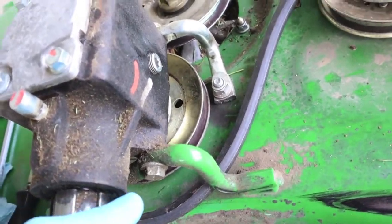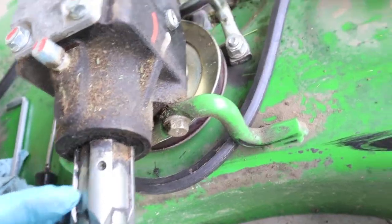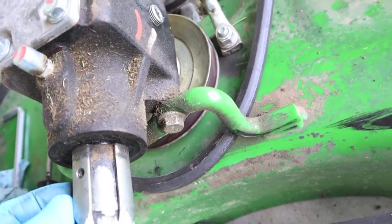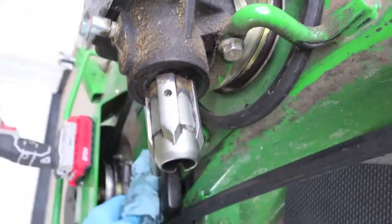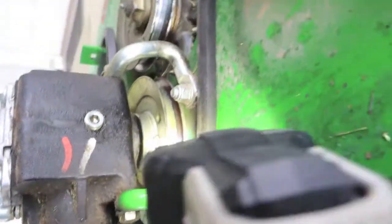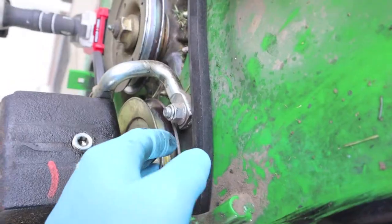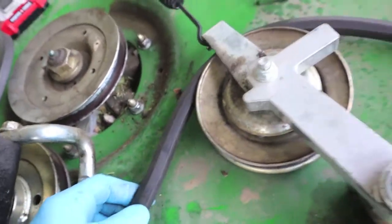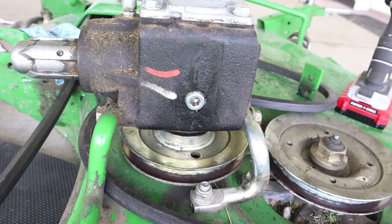There's a little sloppiness here, but this is the input shaft for the auto-connect — it slides on a spline shaft and is held down with an Allen bolt. There's no major leakage here, maybe a little wet, but down here I'm seeing some leakage on top of the pulley. That's how oil is making its way around the deck — it's getting out and slinging off under speed, because there's some on this middle pulley. The belt remarkably seems fairly dry, but I want to show you the pulley: yes, there's oil in it that trickled out, and there's a lot of metal in it.